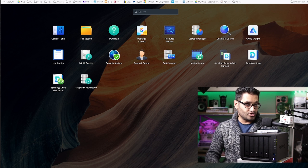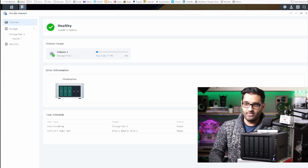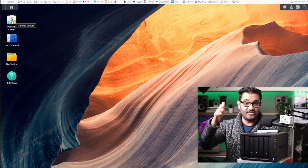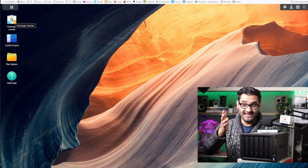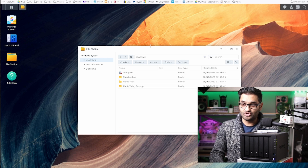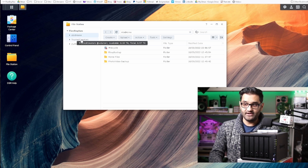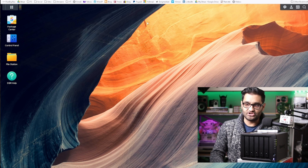So I need to create that account and I'll show you the control panel. When you boot it up this is what you're going to get. You've got a Package Center - think of that like your app store. It's got little programs you can run on the NAS: backing up, media server, Minecraft server with Putty, loads of things. File Station shows you the structure of your folders on the NAS and who has access to them. I've got different people who can access this - three users at the moment. Keep your admin password totally separate and create yourself as another user and log in as a user, just as an extra protection.